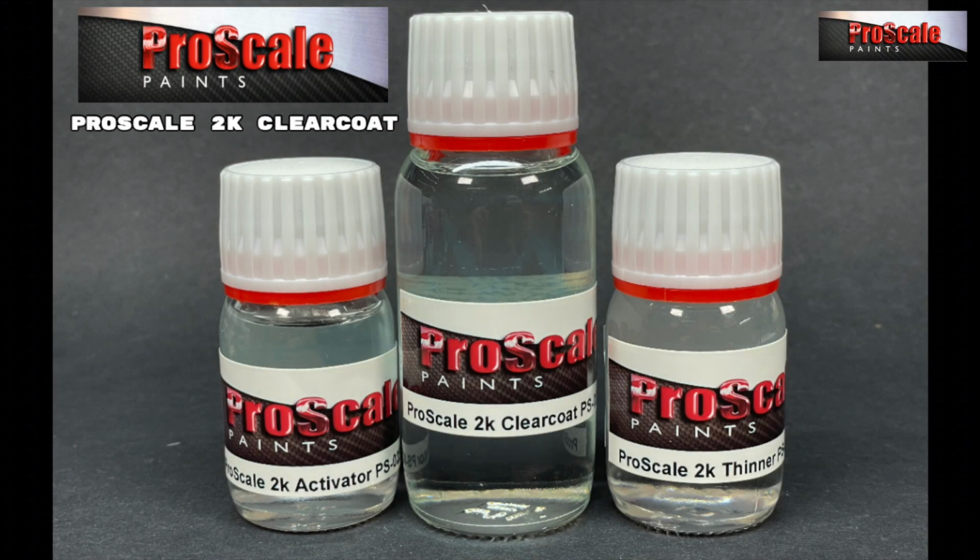Okay, today I'm going to do a run through on how to use our Proscale Paints 2K Clearcoat set. In our set for £12, you get a 60ml Clearcoat, 30ml activator, and a 30ml thinner. It's mixed in a 2-to-1 ratio of Clearcoat to activator with a 5% addition of thinner at the end of the mix. I'll run through in a minute how to mix it and some spraying guidelines as well, and I'll show you how I Clearcoat one of my models.